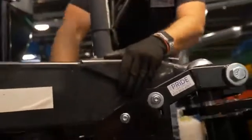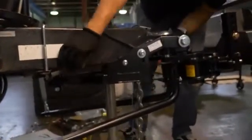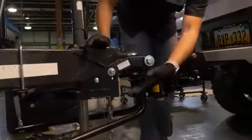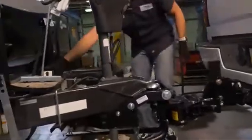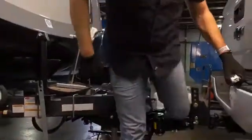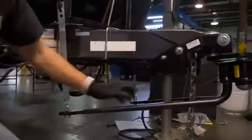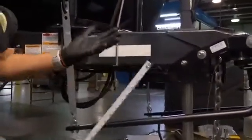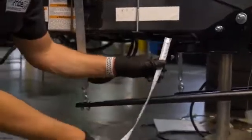So that's actually your yoke assembly. Everything's still loose — the key to this is to have this thing as parallel to the frame as we can. So that means like right here, I'm going to try and get this as parallel to that as possible. Typically it's sitting down like this, which isn't bad. If you look from the side, we say like one to two inches — you may not have one to two inches, that's fine. Some frames are different than others.